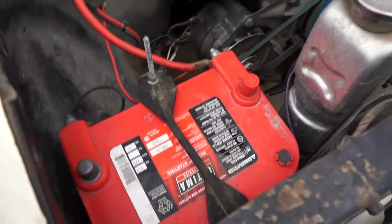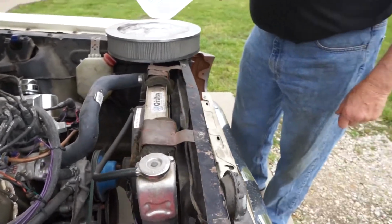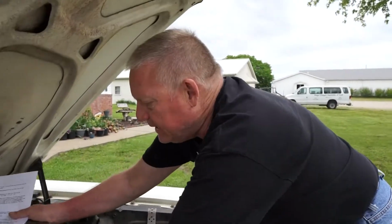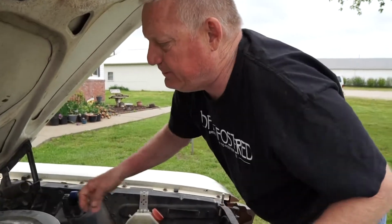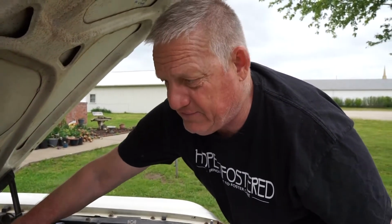They're awesome. Griffin radiator with electronic fan, and I put the Wilwood front disc brakes on it so it stops real good. So let's put the air cleaner back on, and we'll let you hear what this rascal sounds like. With that first gear, it's a 3.15 first gear on this particular T5, and by the way, I've got a good Ram clutch in it that works super well.